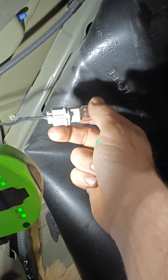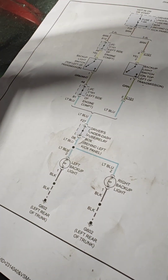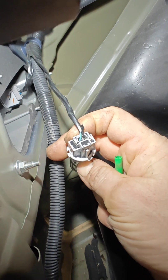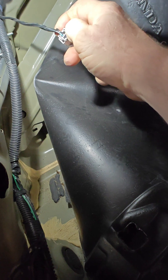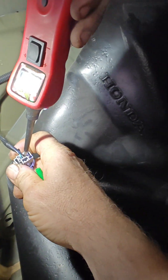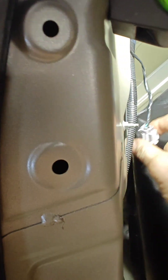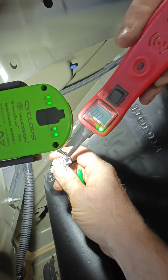We're in the trunk now. One of the reverse lights is already out and as you can see they're not working. We're looking for a light blue wire carrying 12 volts in, and a black wire for ground — and indeed we have a light blue and a black. We probe the black wire and we do have a ground there. You could check that with a high-load test but we're not going to at this point.